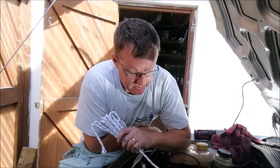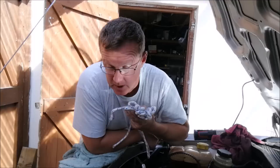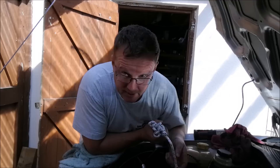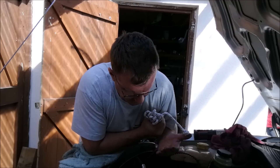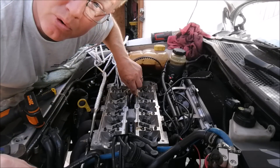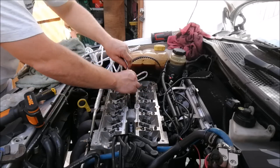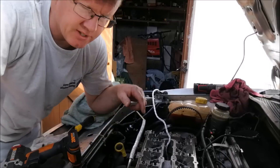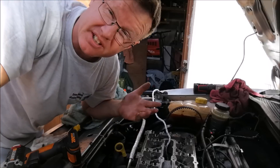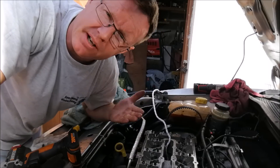So you're probably wondering how I'm going to stop the valves falling into the head - that's where this rope comes in. I've dropped number one cylinder right down to the bottom, I'm going to feed this rope in and then pull the piston back up. The crushed-up rope inside will hold the valves up and stop them dropping. I've never done this before but it's what I've seen - when you put the rope in, try to twist it, try and get the coil and get as much in as you can. It's rammed full now - probably about six foot or more in there.